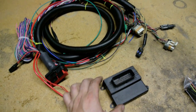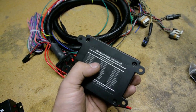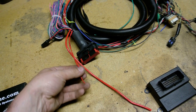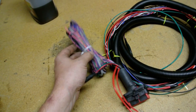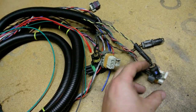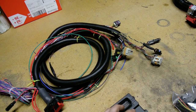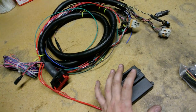How you get a Micro Squirt working is it comes with an 8-foot harness. You can get this modded from Mike already, or modify it yourself — you have to open it up and put some resistors in for it to work correctly. I back-feed the wires using all junkyard connectors and wire everything up to get all your signals working right. What's nice for a Gen 3 motor is you can hook this up and it uses crank position only — no cam position — so you can put whatever cam, whether or not it has teeth, and you don't have to swap the front cover.